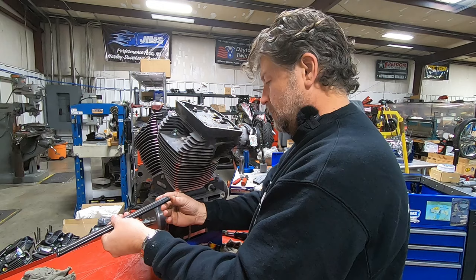This is one of the pre-'07 flywheels, of course, because we've got square top rods and we also have wrist pin bushings in the rods. The wrist pin fit was nice — there's no discoloration, scratches, or scarring there. Since I'm going to be boring the cases on it, I'm not really concerned about the rods here either, so we're going to let that roll.